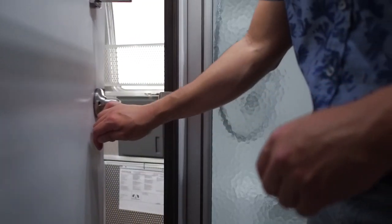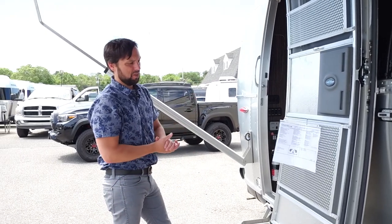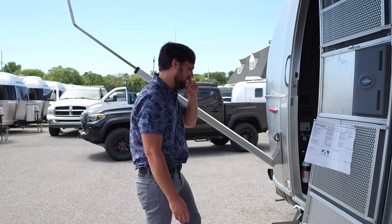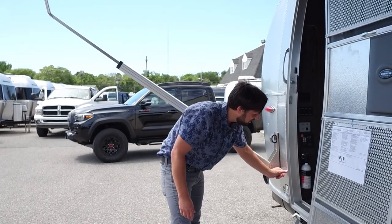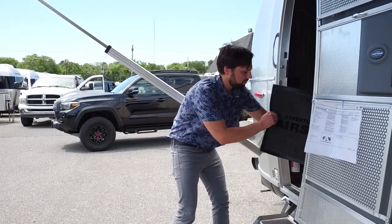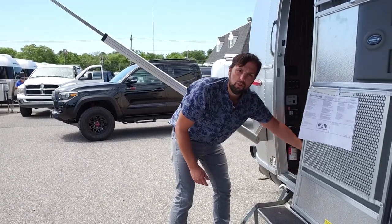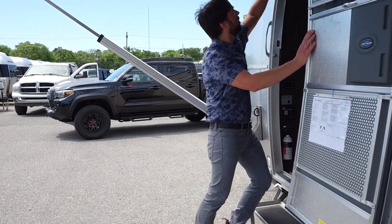Let's take a look outside. There are about eight man-hours in every door — a whole shift at the Airstream plant just to make one entry door. The frame is all extruded aluminum structure, buck-riveted in place and TIG-welded. There's an entry mat, a 45-degree curb that allows you to sweep the trailer out easily, and a gutter rail over the door.